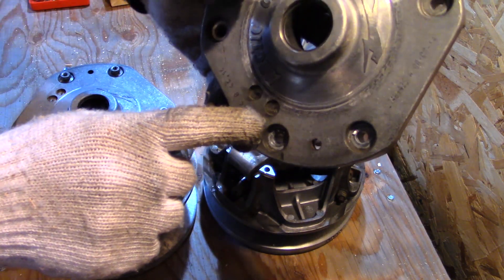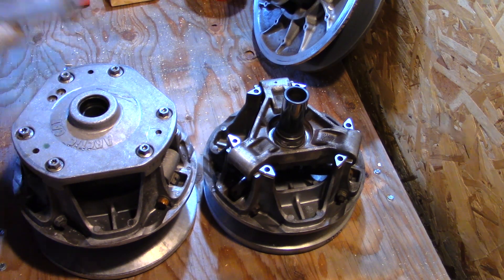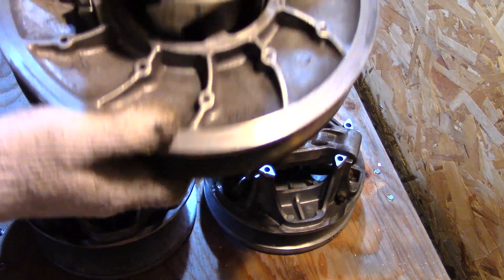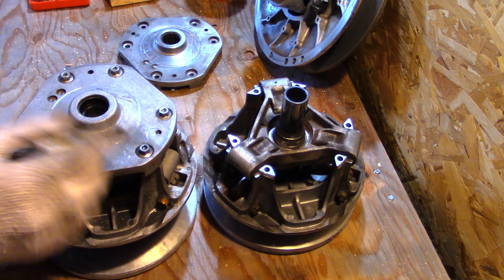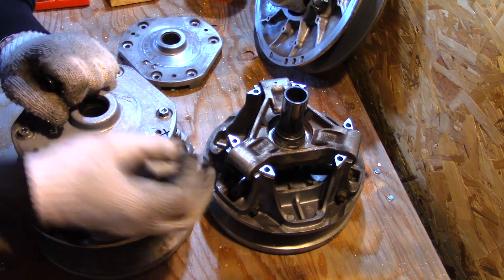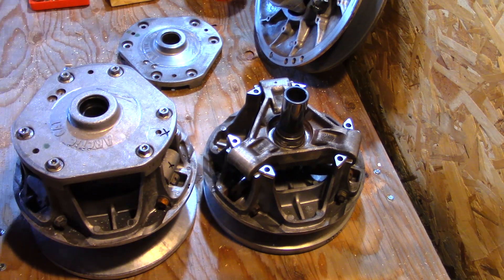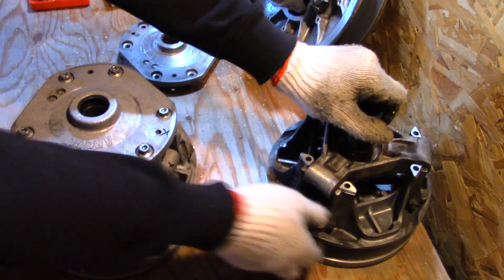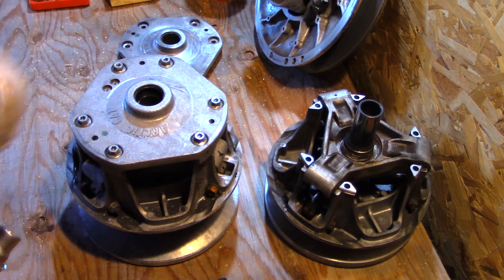You may see like two or three drill holes and they're always going to be in different spots. Even this one is in a slightly different place, and you should see them on a secondary clutch too. On this one the timing marks are kind of hard to see, so I'm just going to quickly mark it for myself. For this one you can use a clutch compressor — I usually don't, just to save time. You just got to be careful with it when you're taking it apart.